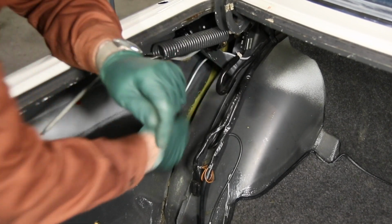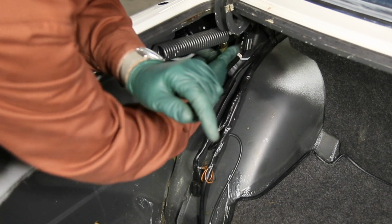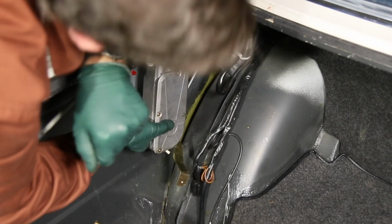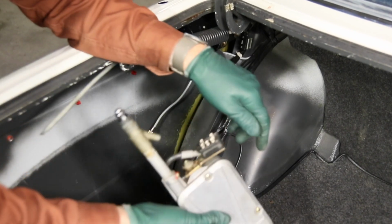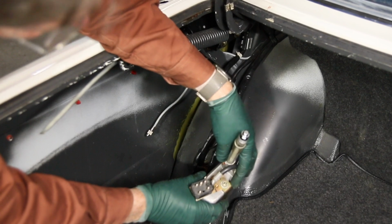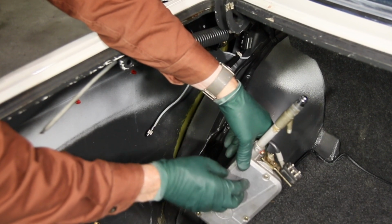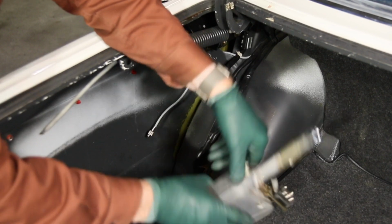When they changed the sunroof motor around 1980 to a round motor, the motor extends further out. And if I try to put this antenna in here, the plug comes up and hits the bottom right there of the motor. So what we're going to do is disconnect that nut right there, and we're going to try to swing this plug over in front of the housing, the cover, and see if we can get this plugged in and make this work, okay?